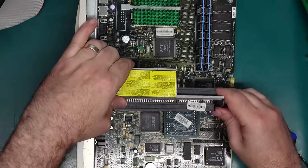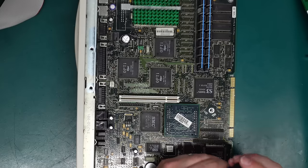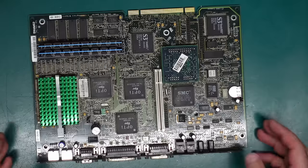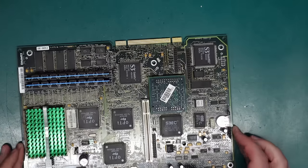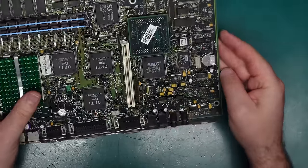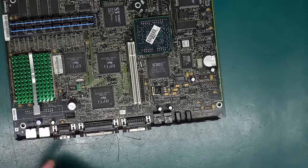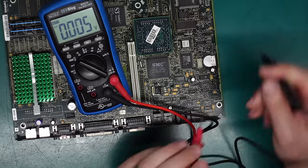With the modem out, the board lifts out — probably needs a bit of a dust. Everything looks pretty good, I'm not seeing anything out of the ordinary. Since this uses just a coin cell battery, we don't have to worry about any battery leakage. The coin cell is spot-welded on a little plate. Let's check the voltage — we have a massive 0.33 volts, so if it were ten times that we'd be fine.